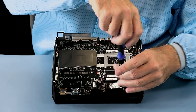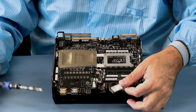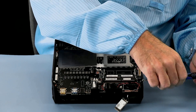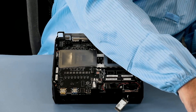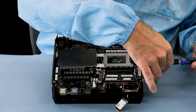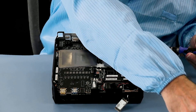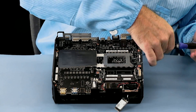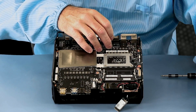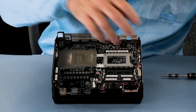We have the M.2 screw that holds the radio in, and then there are three screws on the side. This will just make it easier to get the board out if we get the antenna out of the way. The antenna also has an adhesive EMI sponge on it, so when you start to pull it off it will peel off a little bit. We're going to gently let it come loose and remove it — there we go.